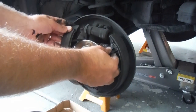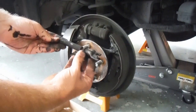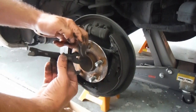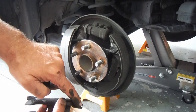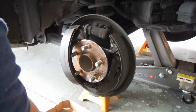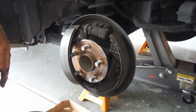I'm just going to pull this apart and see if I can get that to come across. Here's the center piece which is like a little spreader — as that spins out, that keeps your brakes adjusted. We'll clean that up before we put it back in. Just remember the orientation: it has a larger notch that went in the back and a smaller notch that goes in the front, which hooks into that little adjustment arm or tab. That little tab comes off — it sits on that little stud up there.